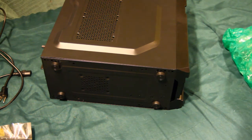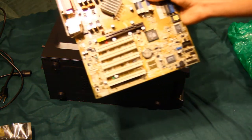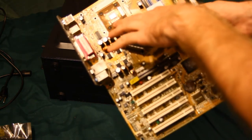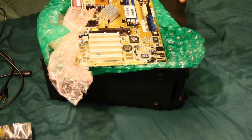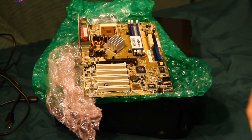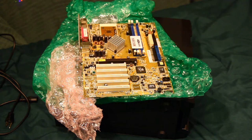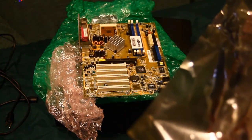The motherboard, as you might remember from another video, is the ASUS A7N 8X — I think it's 8X. It's got an Athlon 2100+ in it right now, came with the board off eBay. This board has an AGP Pro slot on it, so it has extra pins mostly for power and stuff like that. Since I picked up this particular board, I figured I would go with an AGP Pro graphics card — and the AGP Pro graphics cards out there are pretty much all workstation cards.